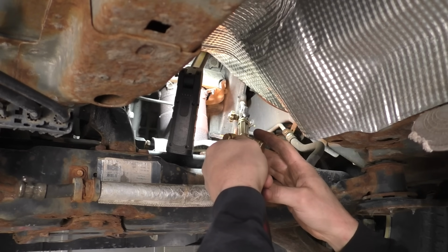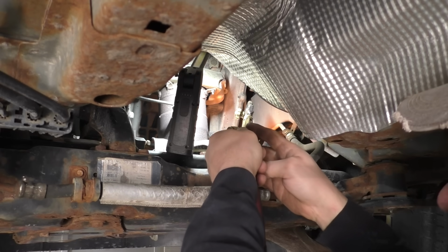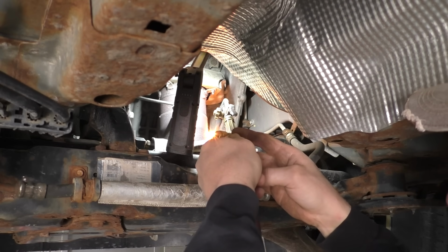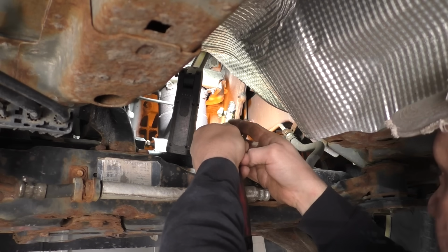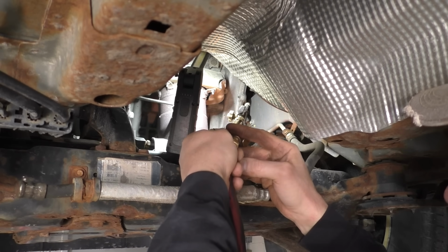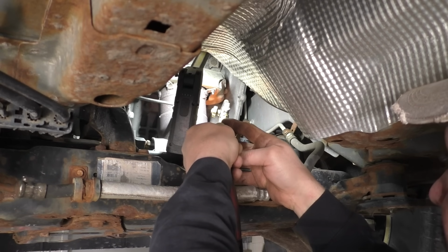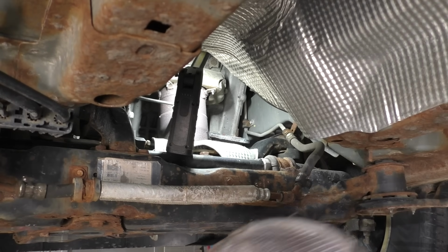Go right around that exhaust flange, and that old gasket will curl right up on there. Once it starts curling up, just keep heating it. Easiest way to clean the exhaust. I do it all the time for cleaning exhaust gaskets. Make sure it stands up straight. There we go. Gets all the rust and crap off the flange too.